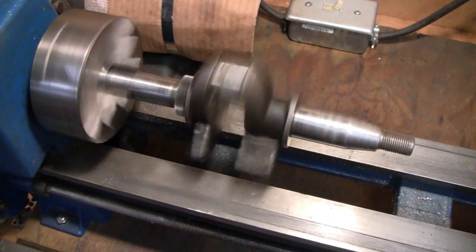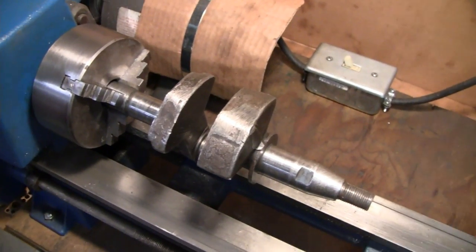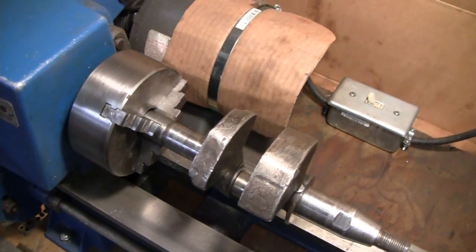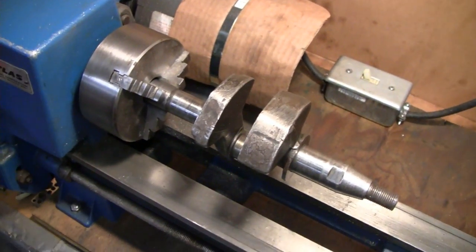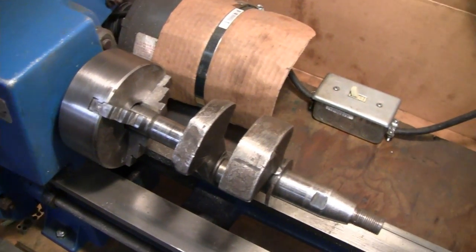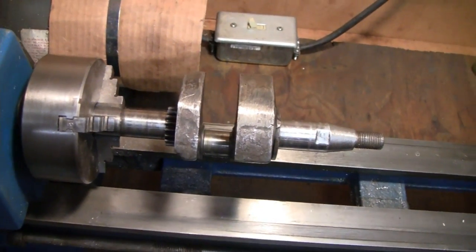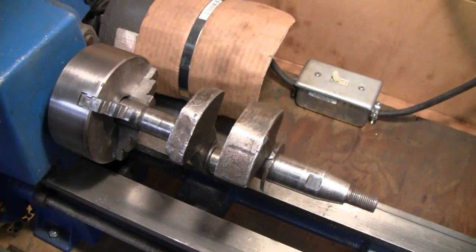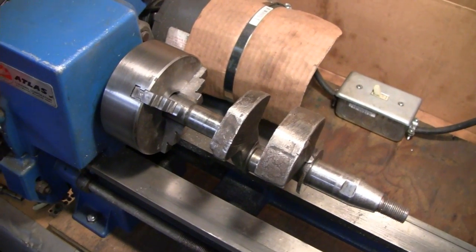Alright, so I would have found out that crank was bent eventually, but probably after the engine was put together and I seen the flywheels wobbling. So I appreciate both of them comments there. Road King likes them kind of comments. He saved me a lot of time, because right now it's easy. I can straighten this crank with no problem. But after I put it together, then I would have had to take everything apart, and everything would have been greased up, and it would have been a headache.